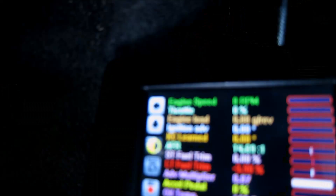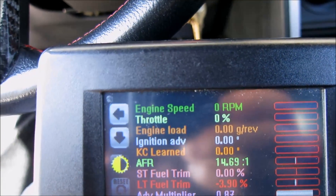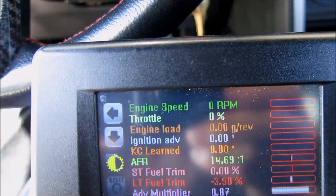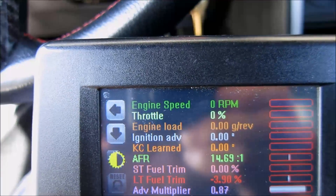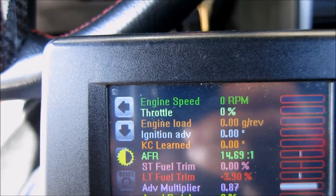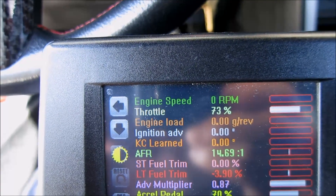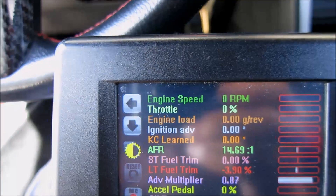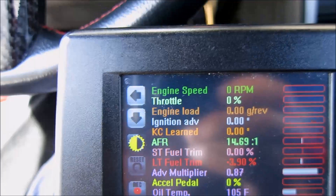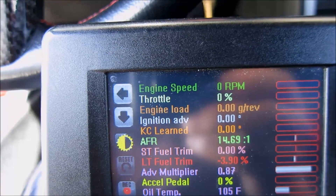As I will demonstrate now — I finished adjusting through my system of trial and error. The throttle position switch, the 2 PSI of the electric supercharger, should come on at 75%. Let's see if I did a good job. Now you will see and you will hear the electric supercharger start its first stage. Here we go. Did you hear that? That was the first stage of the electric supercharger. Of course the car is not running right now, but the electric supercharger will run even if the car is not running — it will start blowing. And it started at that point at 75% throttle, which is exactly what I wanted.